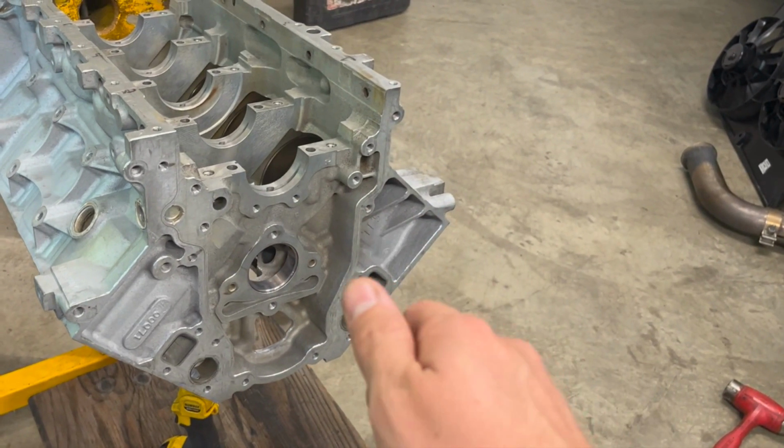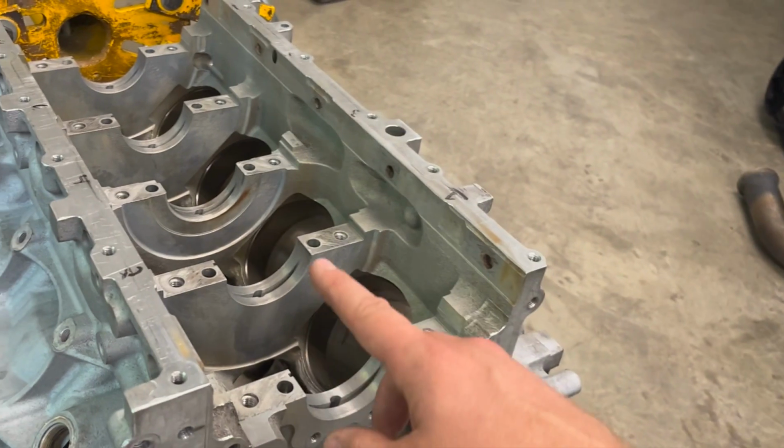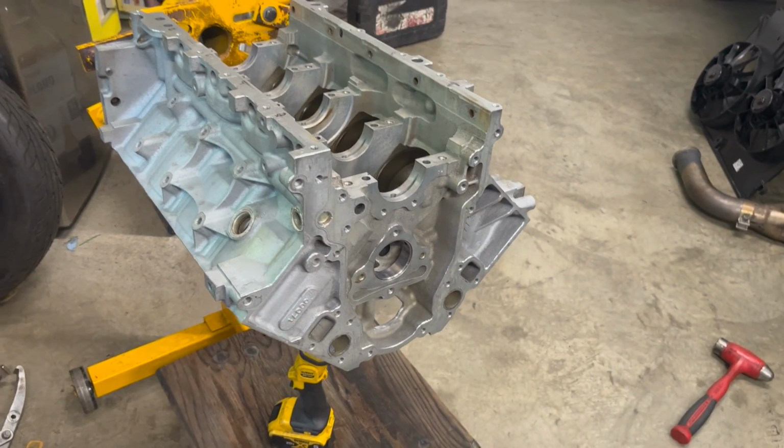So I was able to turn it, but it would kind of stop, and I'd turn it and it would stop, and I'd turn it and it would stop. That's the out-of-roundness of the actual cam in the bearing surface, just hitting a high spot and a low spot. I thought maybe when I installed everything that I screwed it up, right? Because this is my first time.